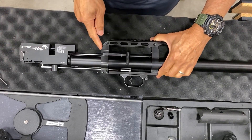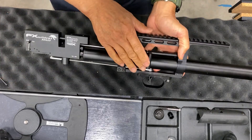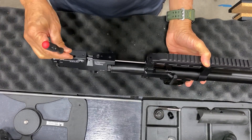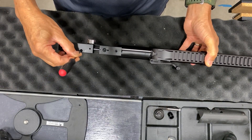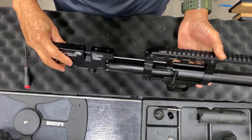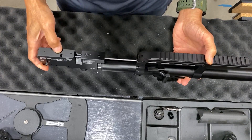When you take this apart, make sure you measure here to here with the caliper. But usually, if you take note of this little hole here — there's a little set screw for the probe — that set screw is in this position. So when you put it back, make sure you see the little screw down there to confirm your transfer port is aligned. This linkage and everything needs to be aligned with the transfer port. It's a quicker way of reassembling and finding the right alignment for the probe.